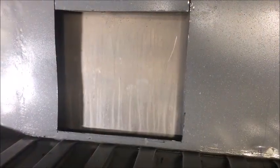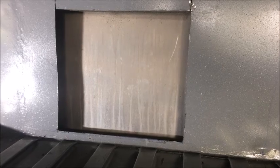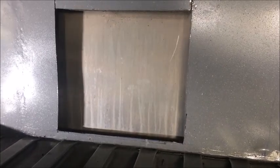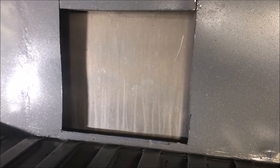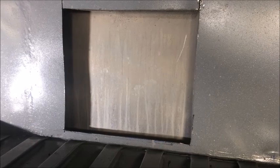The first hole — this one's for the hot water system. But I didn't see this coming: they've got a steel structure to hold the bins together and it's double-skinned, so I'll have to go through both of them. When I bought this bus, the guy said to me you better fix all the water leaks and reckoned that's the only thing wrong with it. I'm cutting into this panel here and there's a solid beam across here, and the water's coming down through the windows and sitting in between these two panels on that beam.